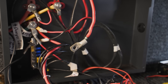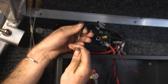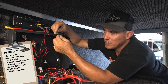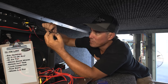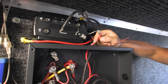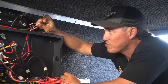A lot of people make a mistake when joining their connectors. We just unbolted this one and the connector came straight off. It has been soldered, but obviously that connection has broken off over time — they tend to do that, getting a little bit brittle, and it hasn't been crimped or soldered properly. It's little things like that through your whole 12-volt system that make reliability questionable. Look at that — it just pulled straight out. And the best bit about not being fused is that causes a fire almost straight away.